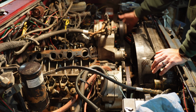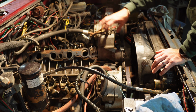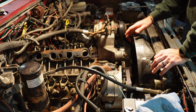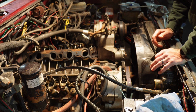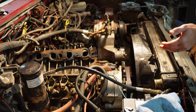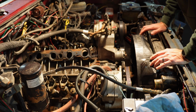The AC compressor and the power steering pump, it's all connected to the same bracket, and I've been able to just pull it and set it aside and get access to the front end, so I'm hoping that's what I can do again here. Then get the radiator and the AC condenser core out of the way, and hopefully that camshaft will come out of there.